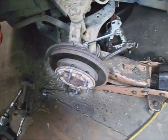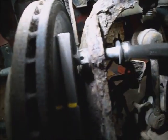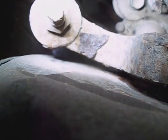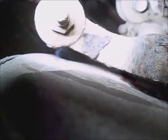That's the back brake plate shim dust cover. I'll probably spray some more stuff in there just to help it along. Once you get it moving, it ain't so bad. Sometimes if it doesn't want to move and you got a pretty good load on it, you just leave it set for a little while and it'll start popping. Looks pretty good. Got the back moving. I drove a chisel in between the inside of the tie rod end, outer part, and the brake shield there. I got the front of it moving. And I believe it's ready to come out of there.